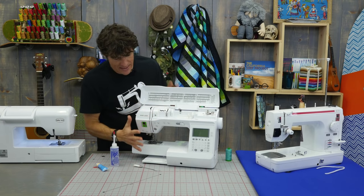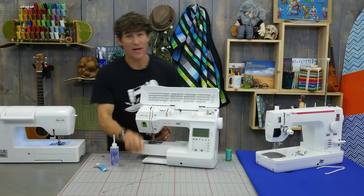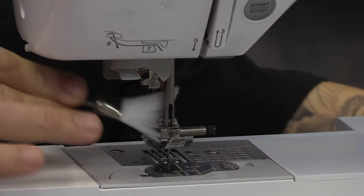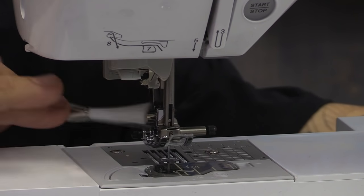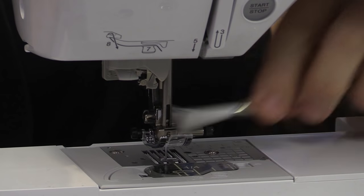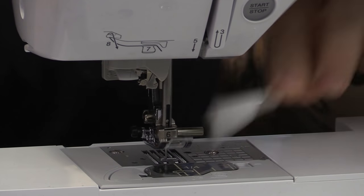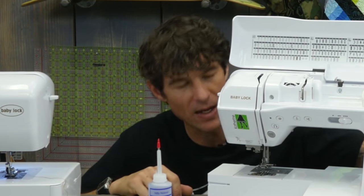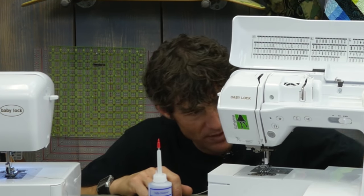As we're dusting our way down, we're moving all of our lint out. Another place I find a lot of lint builds up is right down here on the needle bar system itself and up in our needle threaders. We can get up in there and clean all of this out — especially if we've done a lot of appliqué quilting, we'll get a lot of glue buildup on the back of the needle.